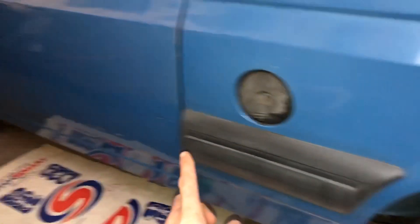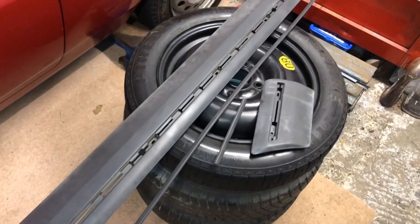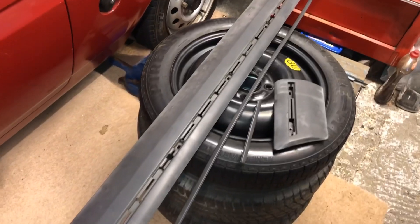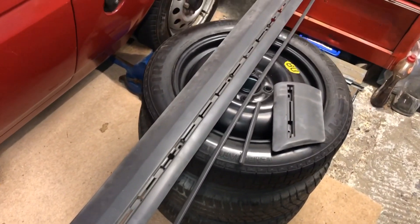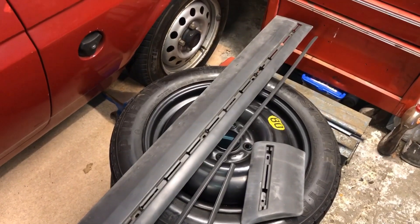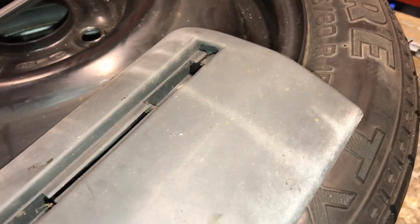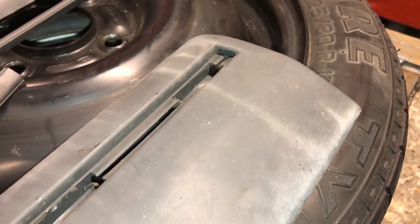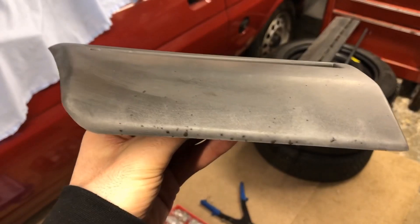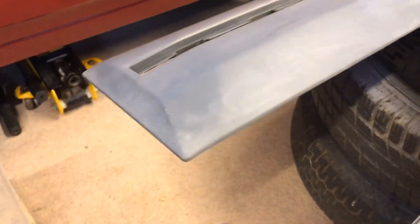Next up I've got to put the plastic moldings from the door and wing back on and tidy them up a bit. As you can tell they're really faded and look quite tacky. The first steps are to give them a good wash and then use glue and tar remover - because tar has accumulated over the years and it looks quite bad. I need to get it off before using the product to revitalize these plastic trims. I've now glue and tarred them and as you can see there's no tar on them anymore, but they're still very faded.